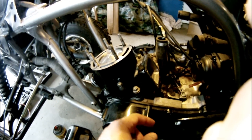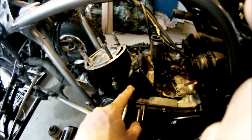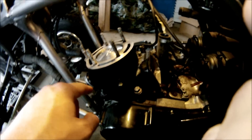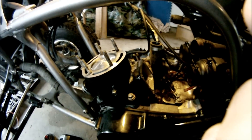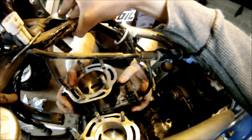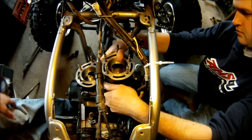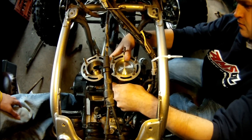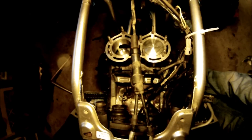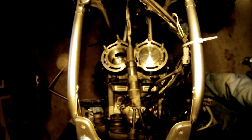I'm going to do it in increments: 10 foot-pounds on each corner and then tighten to 20 and then to 30, just to make sure the cylinder goes on as evenly as possible. Now all eight bolts for the cylinders are torqued down to what should be 20 foot-pounds, but I had to set the wrench to 30 because I had to use that swivel adapter on most of them.